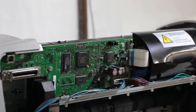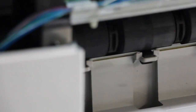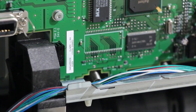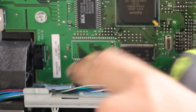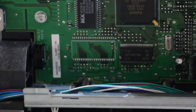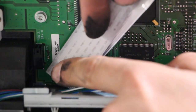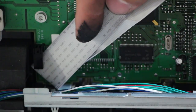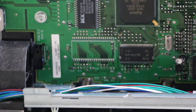This here, I don't know how clear this is, but if you take a quick look, you can see that it's got some really nice sensors. And what they are used for is basically like a photo sensor. So if you need to close a door or to show that a flag is cleared, this is what this is right here. In fact, that door in the back, how this would work is a piece of plastic goes in and cuts the infrared view like a laser. It just cuts it, goes right in, and turns the switch off. So that's what that is.